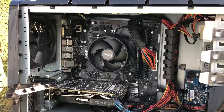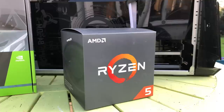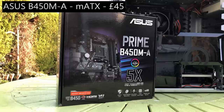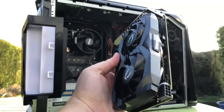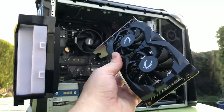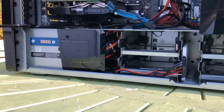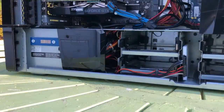A local PC shop is shutting down, so I was able to grab a few bargains on some unopened hardware — they are opening up again exclusively online in a few months though, so that's good. I managed to snag a 6-core Ryzen 5 2600X for £100, an ASUS B450MA motherboard for £45, and a GTX 1660 Ti for £200. The 1660 Ti only requires one 8-pin connector, and this Zotac version is also pretty compact, making it ideal for the small space. I paired these with 16GB of 3200MHz DDR4 and a 1TB SSD, which had to find a new home down a gap, as there are no dedicated bays — a downside of older cases, along with no front USB 3 ports.